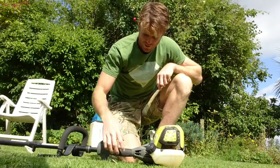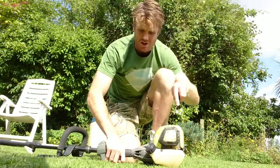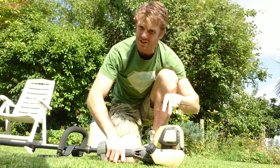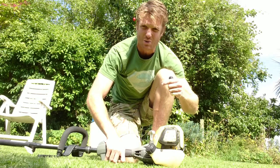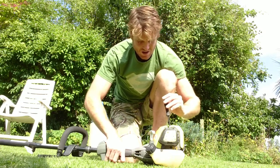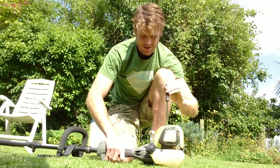I've got it at full open but you'll hear it bogs out — so that's it bogging out there. The idle adjustment is fine, I don't have to adjust that. This is quite a nice idle — you can pretty much take it down to near stall and just give it a bit more. But the key thing really is getting your air screw and fuel mixture squared away.